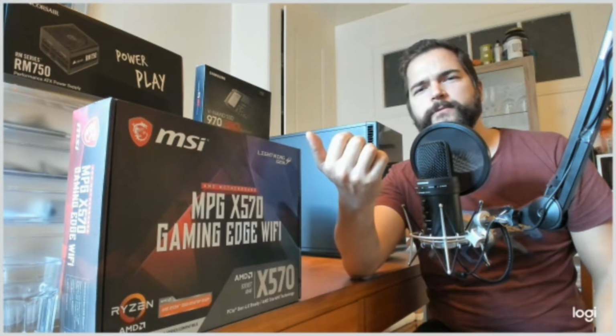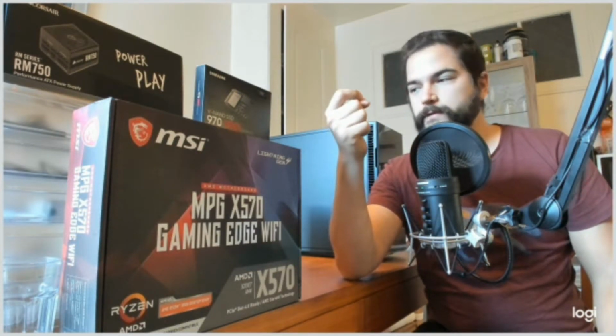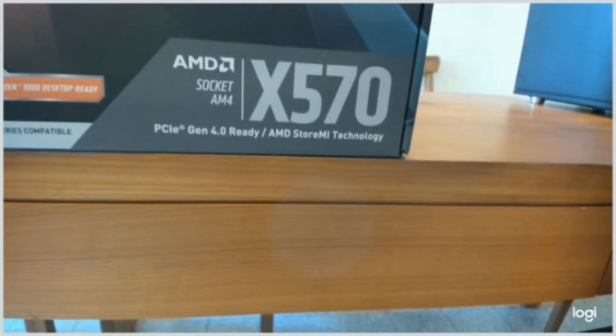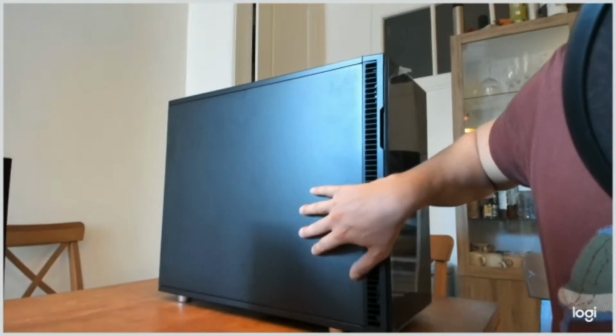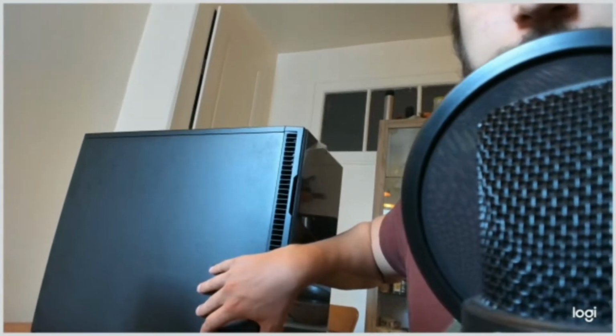Static electricity hazard, and some internet sites write that you should wear a wrist band, but I don't really want to do that. I'm not sure if that's necessary or not. So I just want to take every precaution I have to in order to avoid damaging the components. As I'm showing you right now, I'm working on a wood table without any carpet on the floor, and I'm also working bare feet and with cotton clothing. So hopefully it should be enough. And then I will just touch the case before I touch any components to avoid building up any static electricity.